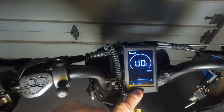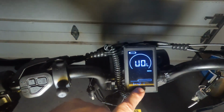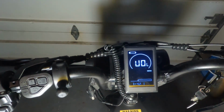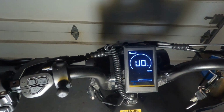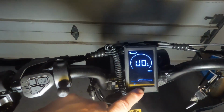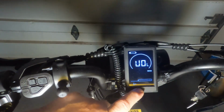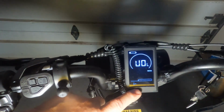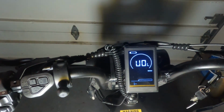At 42.1 volts, which is where I keep mine, you have approximately 20% of your battery capacity remaining. Now, in an emergency, you feel free to use some of that. However, you don't want to bring your voltage down much below 42, 40, 41 and a half maybe. At this point, you're running the risk of shortening the life of your battery if you do this frequently.